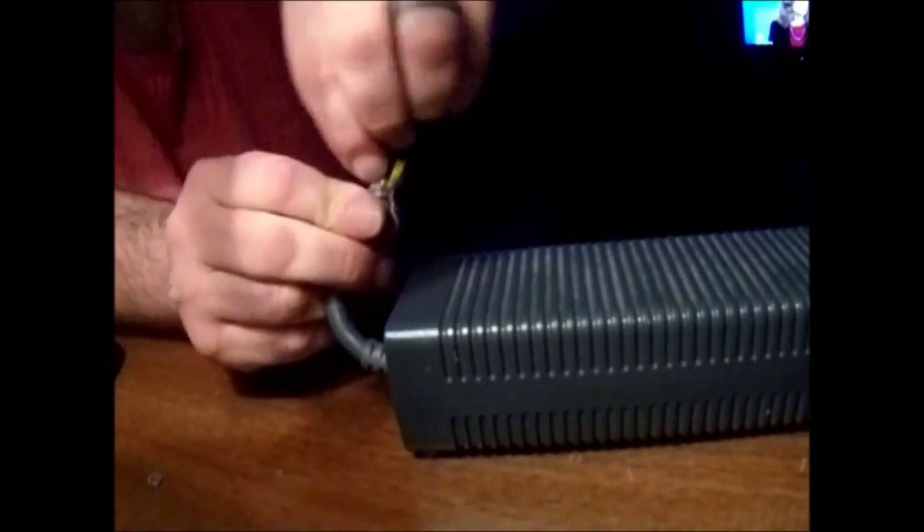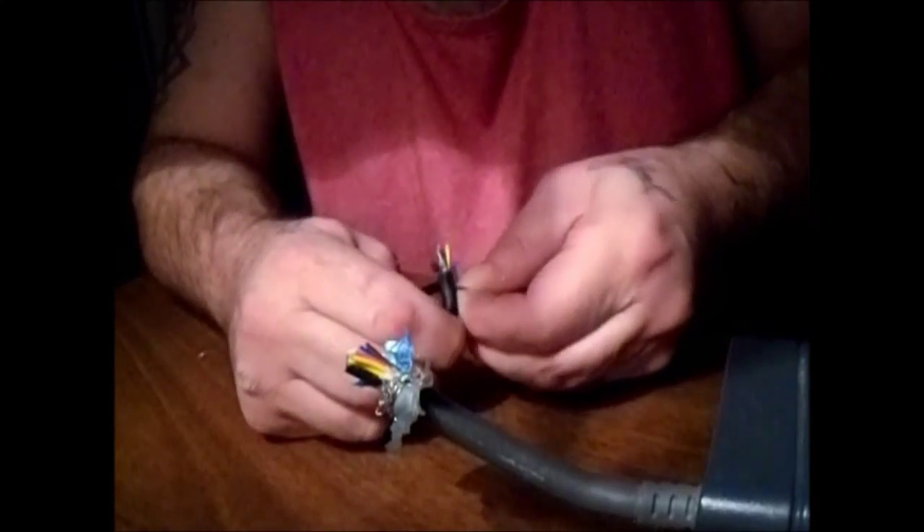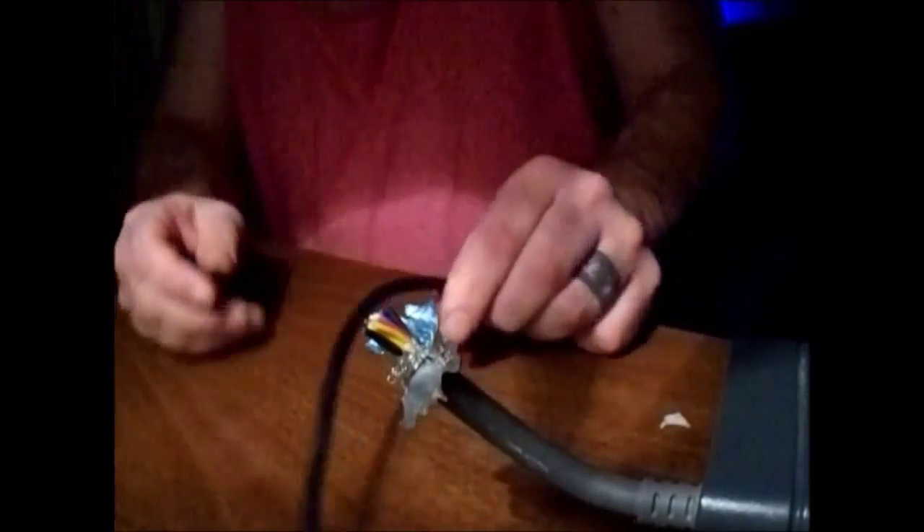My assistant is peeling back all the rubber and the metal surroundings around the wires you're going to need. As you can see, that's all pulled back. You're going to take the other cord that you cut from the Xbox 360 Slim power cord and basically remove that too, so that way you have room to maneuver the wires and rewire them. You want to move that casing back a decent bit — about an inch or two — to give yourself room to twist and make the wire connections.